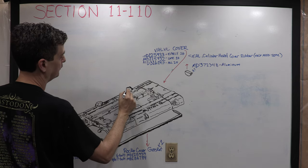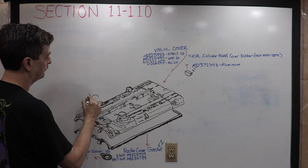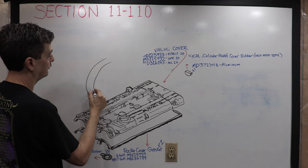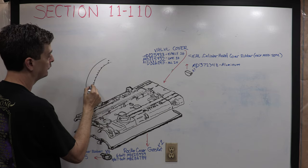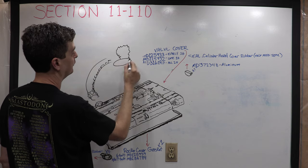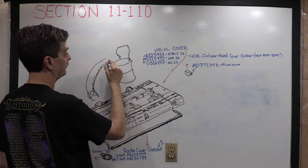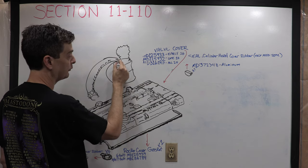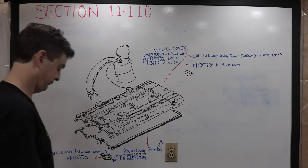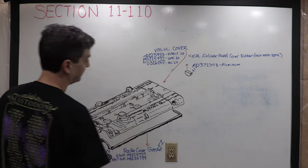Now I have a pair of 3/8-inch inner diameter breather ports, and my breather setup gives me three times the capacity that the old pair of quarter-inch ports used to offer. Under boost, a stock DSM has only one quarter-inch inner diameter breather port, so technically with my modifications using a pair of 3/8-inch ID holes, I have more than six times the breather capacity under boost now. I think that's going to be sufficient for how I'm using this build. I'm likely going to make some more changes in that department, but the bulk of this section really got remedied in the last video.